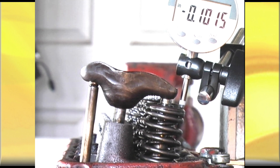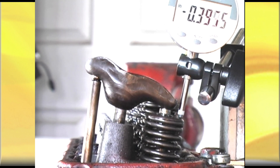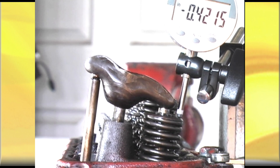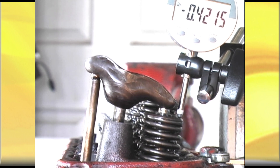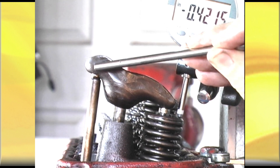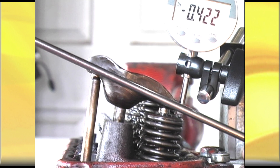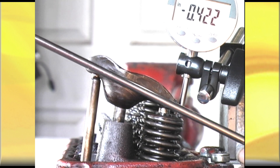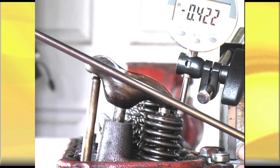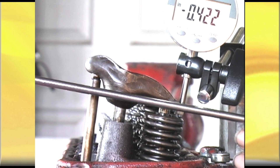As I turn it over, I'll take it over to the centerline of the exhaust cam lobe, and that should give us our maximum lift point. We should be up to around about 0.421 of an inch. And as you can see when you look at the pushrod, it is at a rather sharp angle in relation to the actual centerline of the rocker arm. The centerline of the rocker arm is from the tip through the center of the fulcrum to the tip on the other end. So you can see it's quite sharp compared to where it was when it was back at idle. When we bring this back to the valve shut position, you'll see that the angle here will not equal that angle at the center lift point.